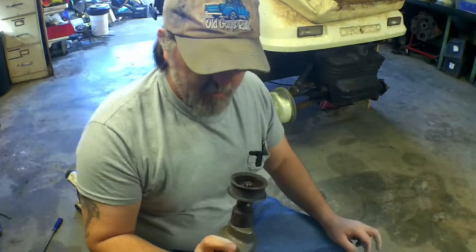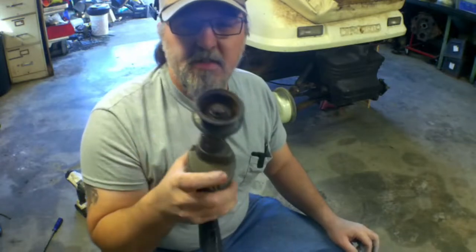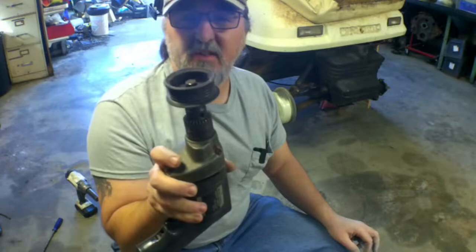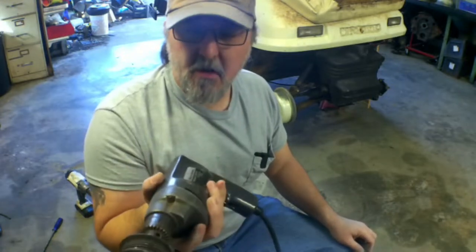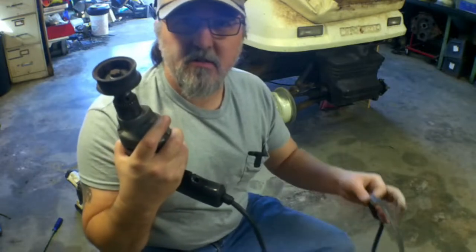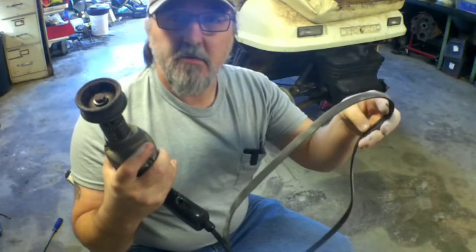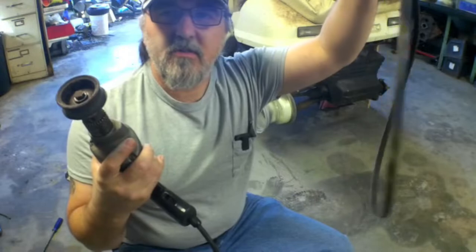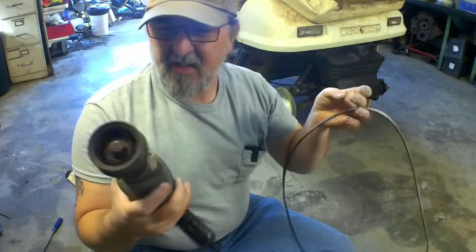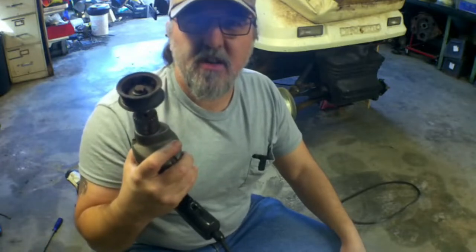In case anybody's wondering what I just did — alternator pulley off of a Chevy. I think it's a five-rib. Stuck a bolt, a nut, and a couple washers on it, stuck it in the drill. Flat belt — it's got four ribs but it works. It's kind of short so I don't have to reach real far. Redneck lathe.